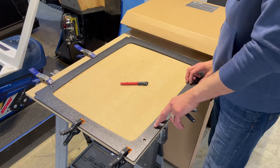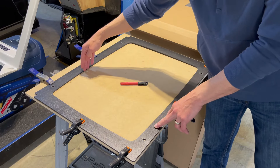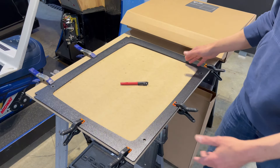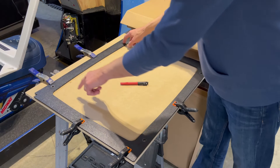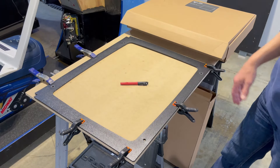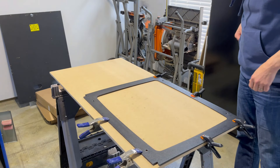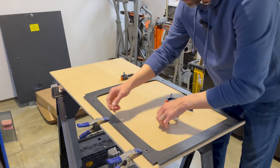What you're looking at here is a filler plate — this really wasn't a bezel, it took up the space between the monitor and the inside dimensions of the cabinet. So this is a perfect template for us to go ahead and mark out and also get the bolt hole locations for the board that we're going to need to use to make a new mount for our LCD replacement. I put these clamps on here just to make sure that this bezel is laying nice and flat.